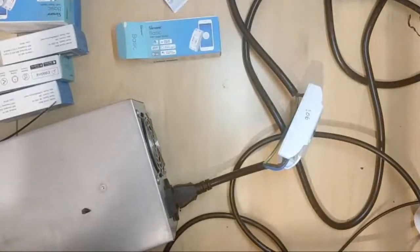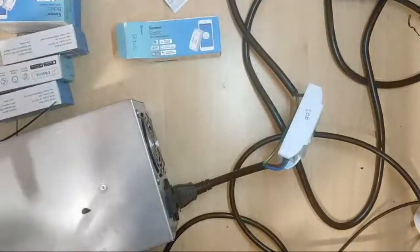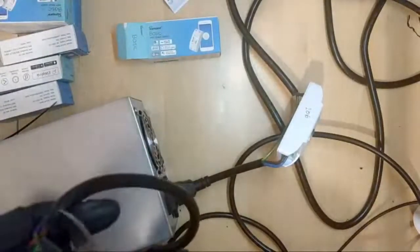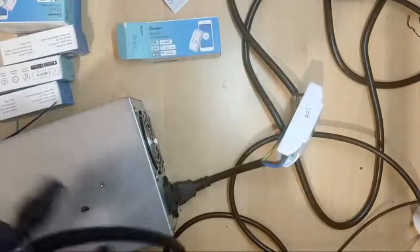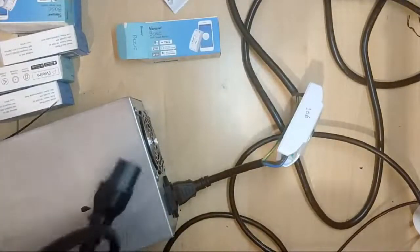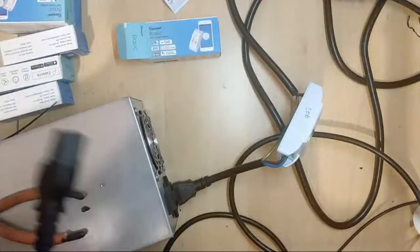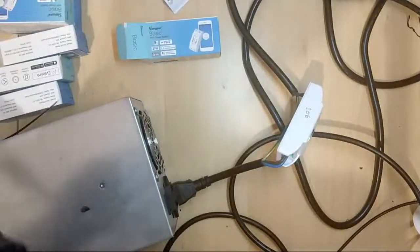Another consideration might be the location of the pool. But the internet's the internet, so it's only a couple of milliseconds difference, unless you're having major problems pinging that pool. That's the only other reason why you wouldn't consider the one at the top of the list. When you do have pools set up, you want to have 3 separate pools if possible. Not just 3 URLs to the same pool, because if that pool goes down, then you're not mining anything.